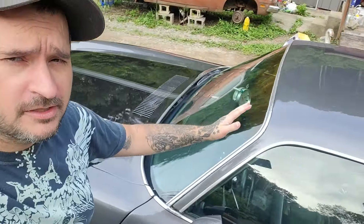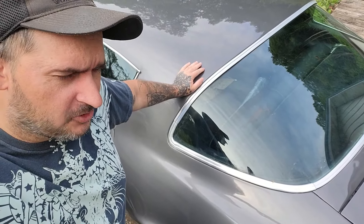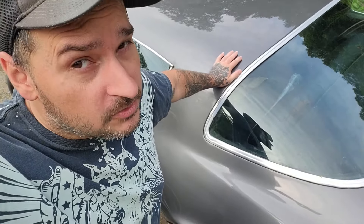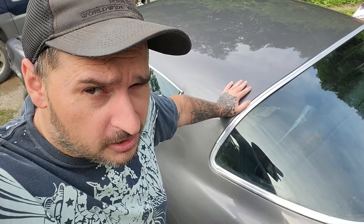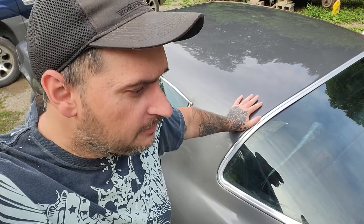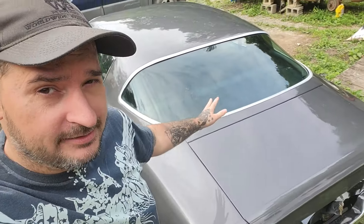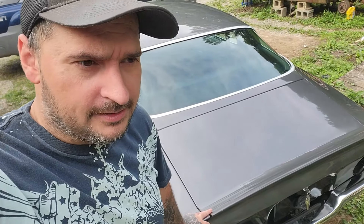I'm going to finish up some more stuff to this car — it's pretty much done. You can see the Maverick in the background. I'm going to clean it up one more time and probably wax it. It's been painted for about two months now. You don't want to go ahead and wax one until it's set, because even though it's dry to the touch, it's still gassing off for about two to three months. But it's been extremely hot outside — baking in the sun and in the building. It's been about a month and a half to two months now, so I'm safe to assume it's safe to wax, and that will give this paint the protection it needs. I will try to make a video on that.